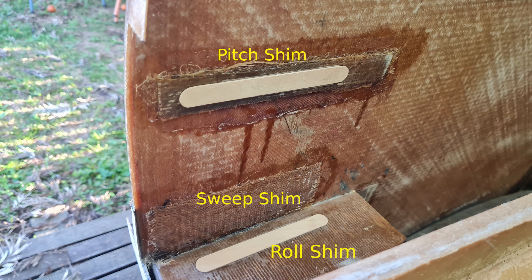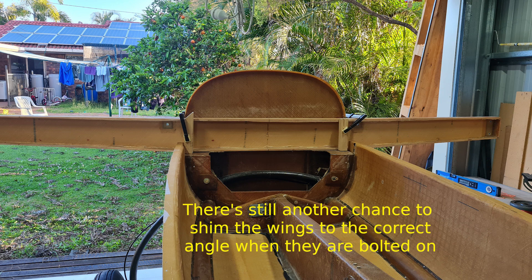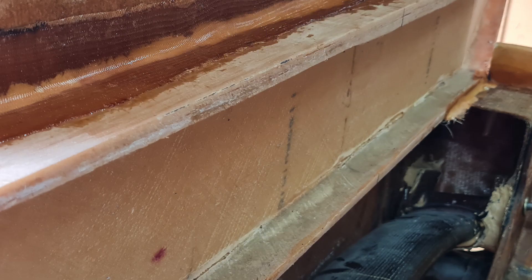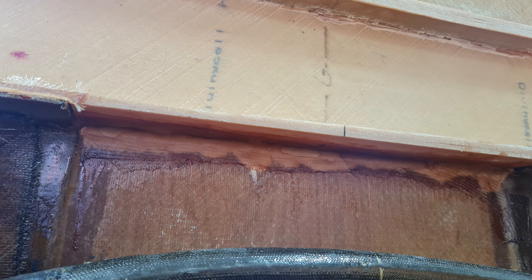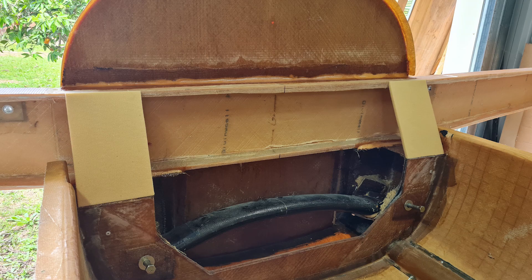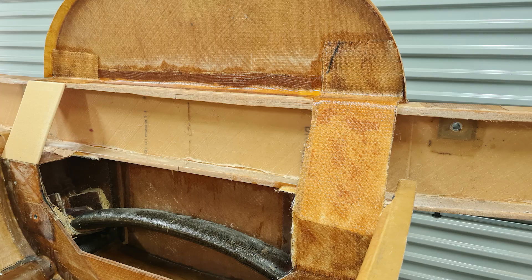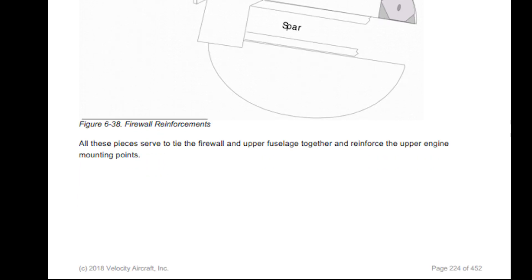On to the main spar. I already did most of the hard work of aligning the spar so we can fly straight. Now the gear was on, I had no excuse and I had to lock the spar in place. A final check with the fuselage level and several test clampings, we applied a generous amount of structural adhesive, clamped in place and waited. While waiting for the adhesive to cure, I mixed up some micro glass to radius the corners between the firewall and the spar. Two layers of bi-directional glass were layered over the corners, then a lot of triax was cut and applied. I had to make little ramps from the gear bulkheads to the top of the spar. The extra layers of glass above the spar serve to strengthen the firewall for the engine mount bolts. There is more glass to go on once the top half of the fuselage is on, but for now we're done.